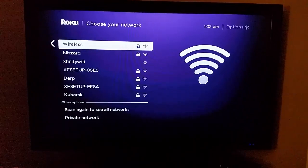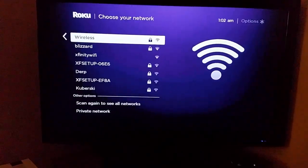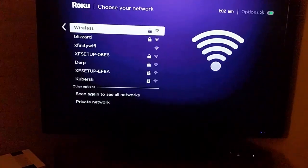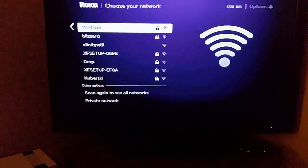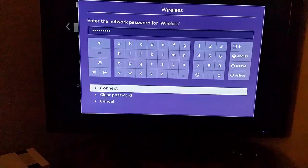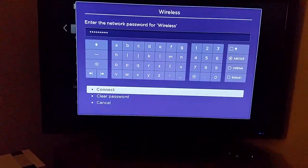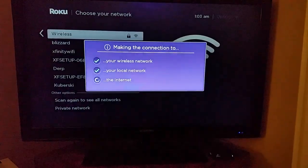If you don't find it, maybe your wireless router isn't hooked up properly or isn't on. Mine is conveniently named 'Wireless' and it's the top one on the list. It's password protected — which you should have as well — so you're just going to click on your particular internet connection and type in your wireless password, then click Connect.